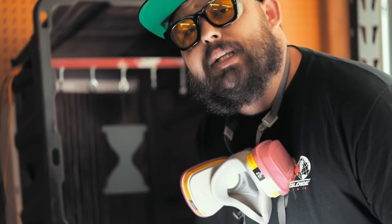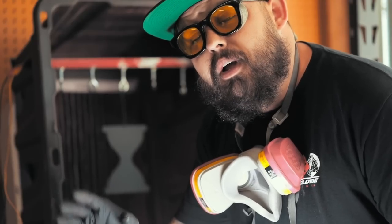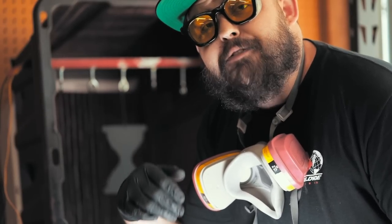You need to be really consistent when laying down your powder — move the gun around to get an even amount across the entire face of your part. One way to check after you're done is by using a high-powered LED flashlight: shine it at your part, and if you see a reflection coming back through the powder coat, you have a light spot that needs to be fixed. Once your part is evenly coated, it's time to throw it in the oven. Most powders bake at 400 degrees for 20 minutes — starting the timer after your part wets out, meaning it looks like it's melting or wet on the surface.